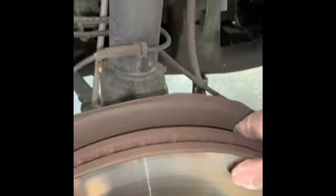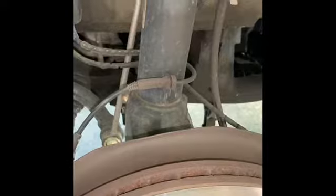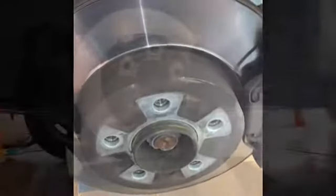This rotor is good to go. I'm not sure if you can see in the video, but it's got a pretty good lip in there, so these rotors have had a good long life — they've done what they wanted to do. I don't think it was this side. This is the front driver's side tire. I don't think this is the one I was grinding — the one on the passenger side is definitely grinding. I should have started with that one. But yeah, I'll let you know how it goes. Pretty straightforward though.